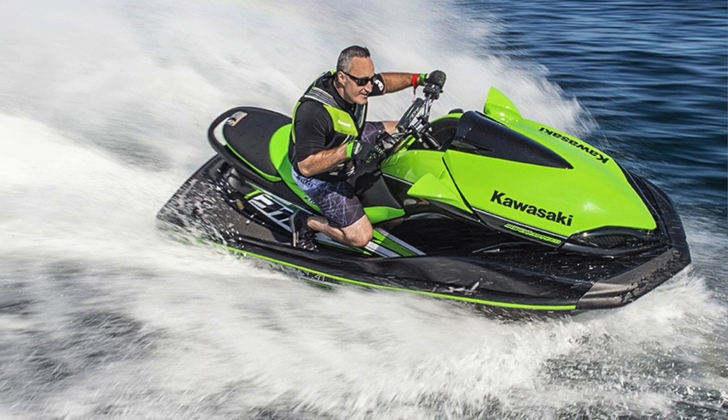There's also another change that they made, and that was with the inner liner. They redesigned the inner liner. Well, they didn't redesign it. Excuse me. They recast the inner liner to a lighter material. They were able to shave off a little bit of the weight gain there. So that's good news. That was something that I thought was a smart move. I don't see anything with the inner liner breaking or giving way because it doesn't have the stress that the hull does. So I think they just were trying to mitigate as much weight gain as possible. Because again, SMC is a lot heavier. All right. Everyone complains about Kawasaki being heavy, but you never see Kawasakis delaminating or cracking hulls.